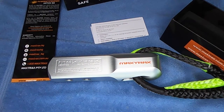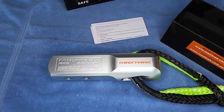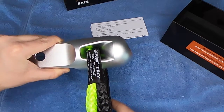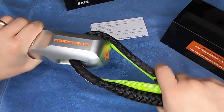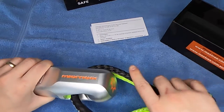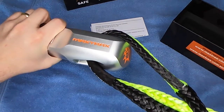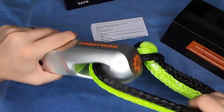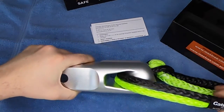Right now I have a monster hook — the swivel hook — on the back of the Jeep. That works fine, but what concerns me about it is when the hook is extended and you put a line on it, if you have any side load at all, that's going to put a lot of stress on it sideways and it's not really designed for that — it's made to be pulled straight back. That's where the soft shackle comes into play. You're not going to side load a soft shackle — whether there's downward, upward, sideways, or straight back pressure, it's going to be fine.